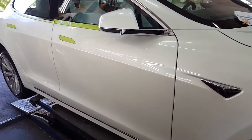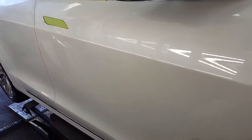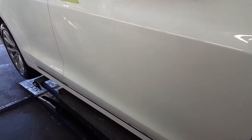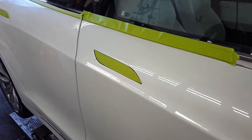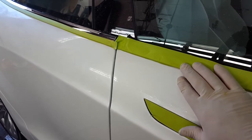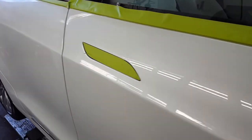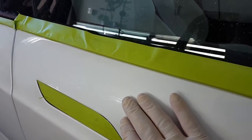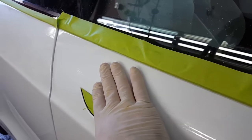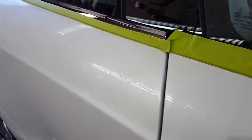Update on this paint correction job — about halfway through. I've already done this lower part and I'll show you the result of that later when I can get back in the lights. Doing the upper portion right now, masking off the chrome components because we don't want to be sanding on those. You can see this area I haven't sanded, and right here is where I have. This is what it looks like once we've sanded on it — see how it's really dull.